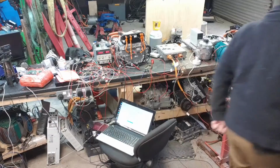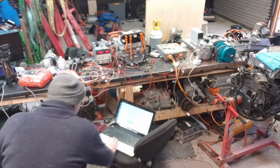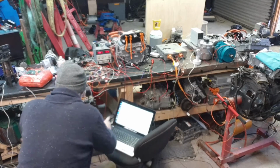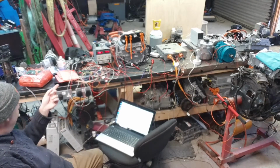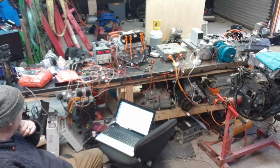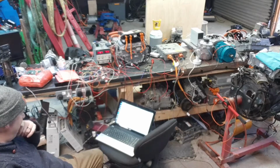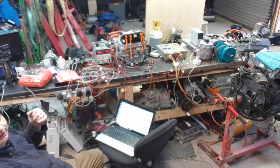Okay, so let's go high voltage on. We will commence sending diagnostic CAN here, and we want to go AC on. And when we go AC on, we jump up on our 12 volt system to around 470 milliamps of draw. But ultimately what's going to happen here now is that our charger is basically going to ignore us. It won't do anything. It's just going to sit here until the CAN log runs dry, and at that point it'll turn itself back off again. So really exciting.